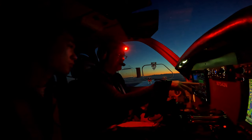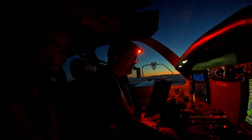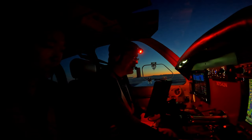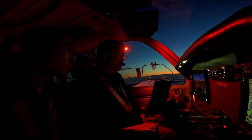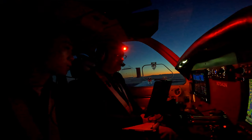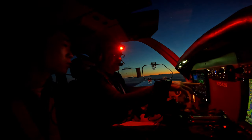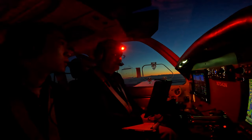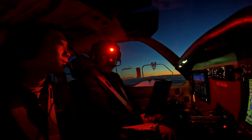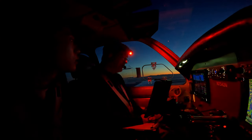All our temps are in beautiful range right now, so we're good there. Put that away. I could actually bring the fuel consumption down a little bit, and it'll give up a little bit of our true airspeed. What'll happen is interesting: you'll see that we can get above 1500 for our EGTs fairly easily. That's not a big issue. It's the cylinder head temperature you worry about. Yeah, that's the thing.